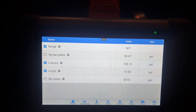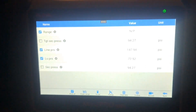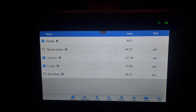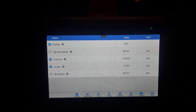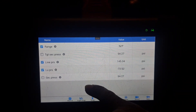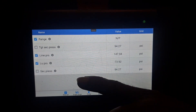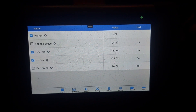Alright, just got off my test drive. I drove 3.3 miles — customer-supplied transmission, that's all you get. Look at the values — everything's working fine. It moved on its own weight, didn't have any issues over those 3 miles. In the future, if anybody has problems — especially me, because I don't get a lot of CVT transmissions — I'm definitely going to try to utilize these line pressures for diagnostic purposes.